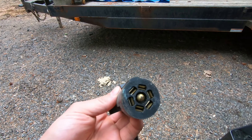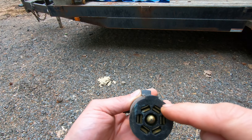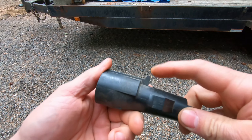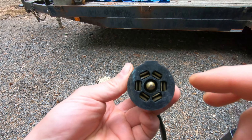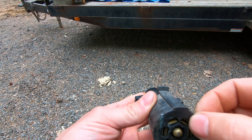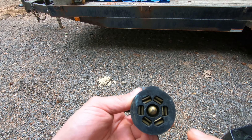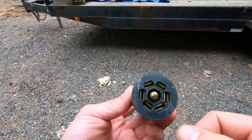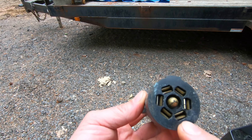In this plug you have a group of wires — seven pins. Looking at the connector, here's your little tab that usually goes up, which locks into the cap. The upper left one is going to be your power — it should be a black wire, so this is your 12-volt power. The one down here is your ground and it should be a white wire.